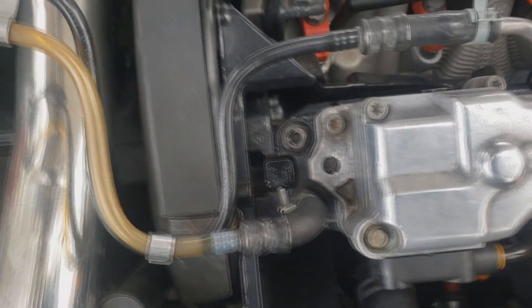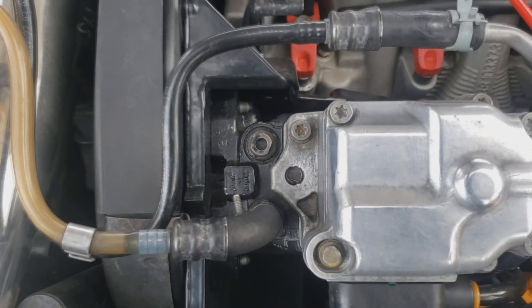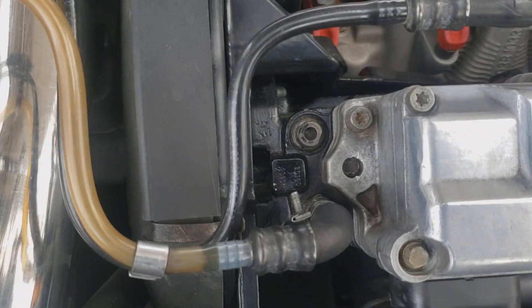When you remove that valve you will have air in your lines. If you don't have a lift pump like I do, you may have to bleed the injection pump once you're finished. Alright guys, that is the keystone mod.